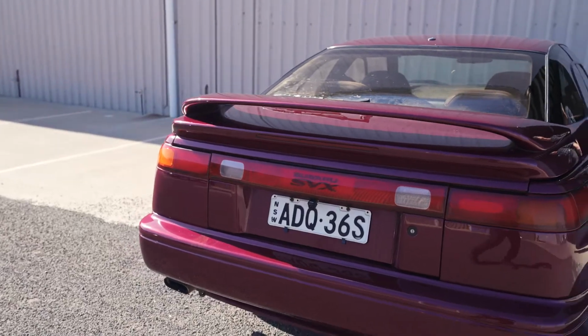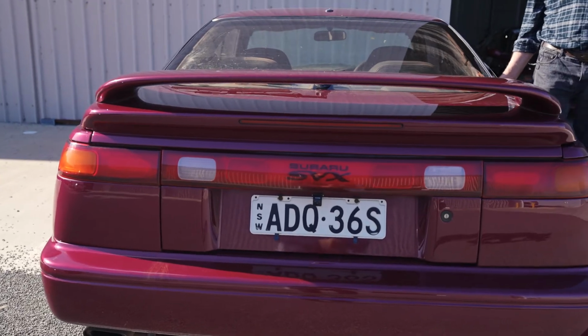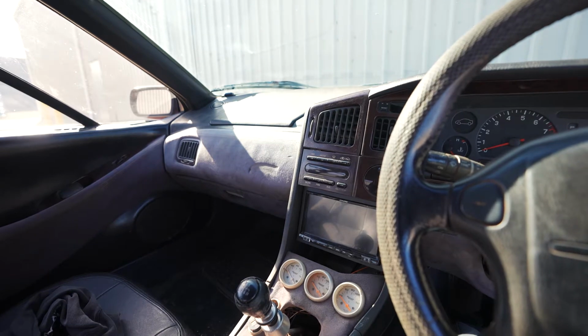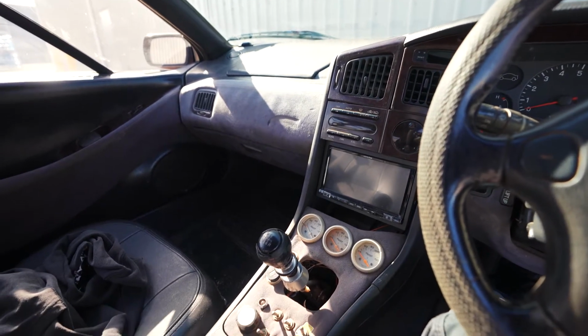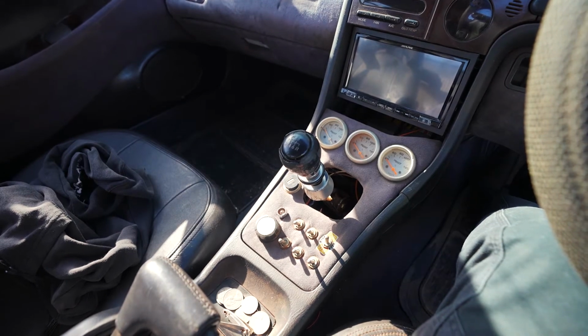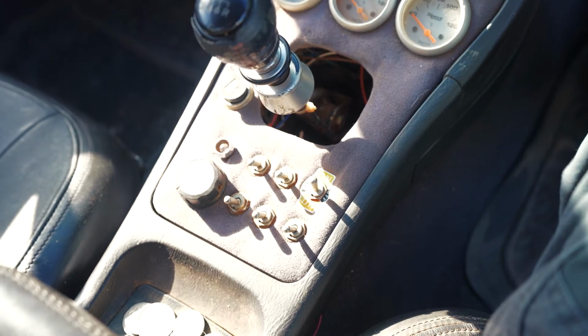Basically, had a couple of engines. First engine did 480,000 Ks and I filled it with mud in the desert one time in a rain shower. So what we did was we hacked into the wiring harness and we were able to control the radiator fans from internally, so at low speed in sand we could keep the engine cool.